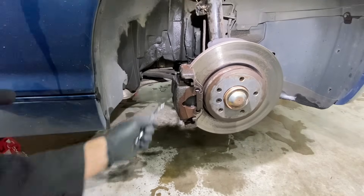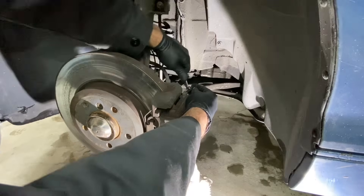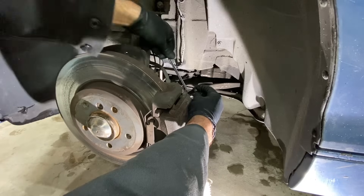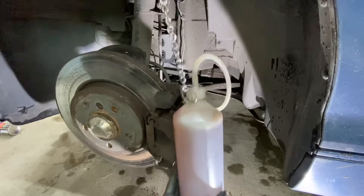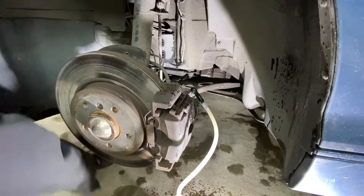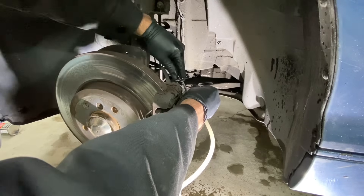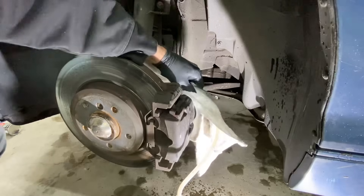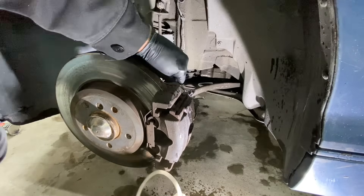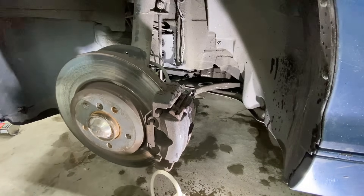Always check your bleeder screws — it's always good to double-check them with a wrench. And last but not least, front left. In my experience, the bleed times usually get shorter as you get towards the front left wheel. I'd call that a full bottle, so now we can shut down our last bleeder. Double-check the bleeder one last time, make sure it's nice and snug. Reroute the brake wire and clean up after yourself.